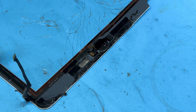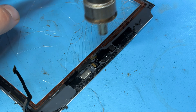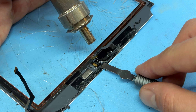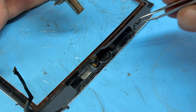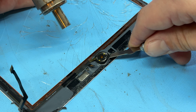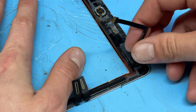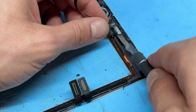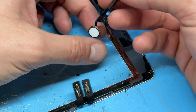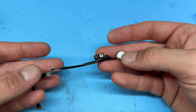We can put the chassis to one side now. We're going to get the broken screen and remove the home button safely without causing any damage to it. I'm going to use a heat gun at 200 degrees C, circling around it to get it nice and warm. Then using the number 17 Exacto blade I'm going to lift up that part of the bracket, then this side of the bracket, and use the tweezers to pull that away. I'm going to do the same getting right underneath the home button and separating it from the device — we can peel up the flex cable at this point and separate it all. The rubber gasket came away too — I'll explain how to reinstall that in a second.